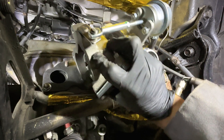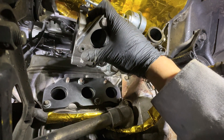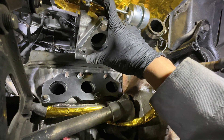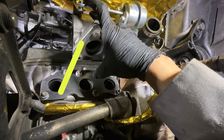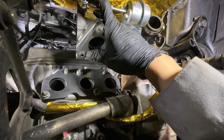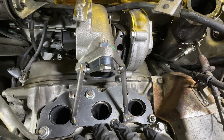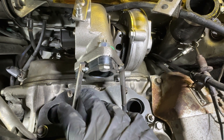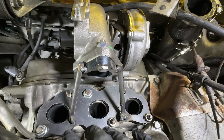So the next thing I'm going to do is have the turbo generally placed as high as it could possibly go without running into the firewall or the engine here. Then I need some steel rods to connect the turbo inlet flange to the exhaust flange so I can get the relative positions of it, and then we'll unbolt everything. We got the turbo mocked up on the engine, and there's just enough clearance between the turbo and the valve cover and also the firewall, so I think we're in pretty good shape for right now.